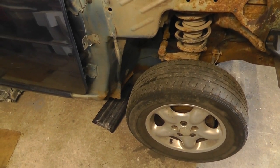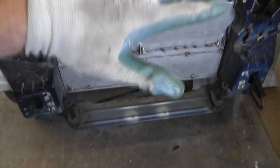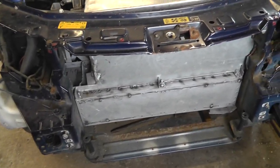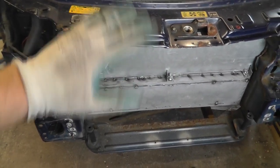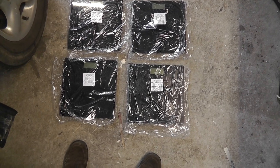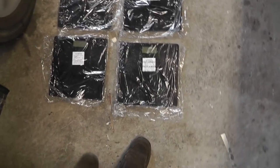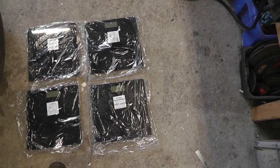I'll just read out what the numbers are. To do this properly, the car will have to be level, so all four wheels will need to be sitting on blocks of some sort to keep them at the same height. Then I plan to jack it up in the middle, take it up in the air, set it down on the scales, weigh it, jack it up, swap the scales around, set it down and weigh it again. Before I start this test, I want to ensure all the scales are reading more or less the same — they're obviously not precision instruments at 10 pounds each.